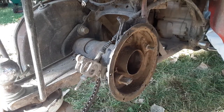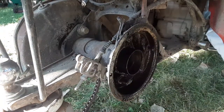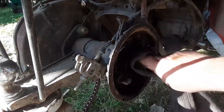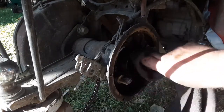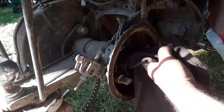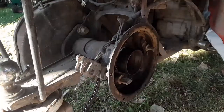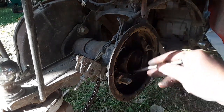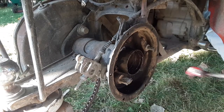Okay, I'm back. Got some brake parts cleaner. I think I should have done this to begin with. I'm just going to clean and pull this out. This feels pretty good - I don't think I need to sand it or anything. And then I'm going to take some AutoZone axle grease and just do like this. I'm going to put a big old gob in here as a preservative. Grab one of these new bearings.